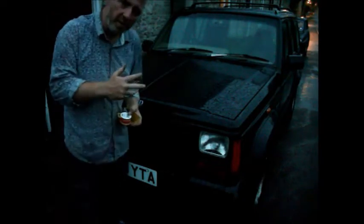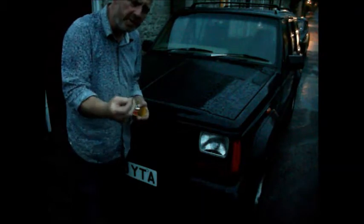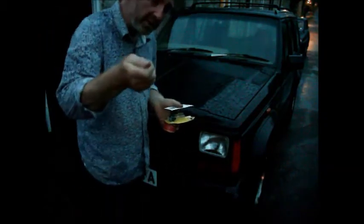Now if that doesn't work, I can go into the steering column, into the ignition switch, and see if I can pull some power or some feed off the ignition switch itself and then just rewire that direct to that starter relay that we saw underneath. But if the worst comes to the worst and I can't get any power going on there because of the way the immobiliser is set up, or it just gets too complicated, I've got here a generic starter button switch and a generic relay and some wire from Halfords. So I can stick the starter button somewhere on the dashboard and have ignition on the key and then hit the button to start it. But one way or another, I'm going to have this car driving.